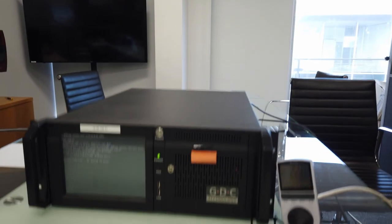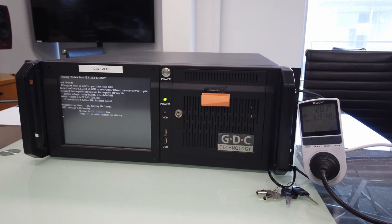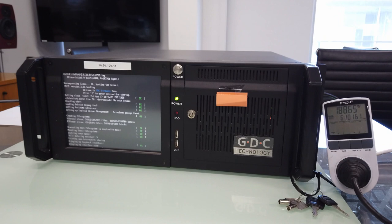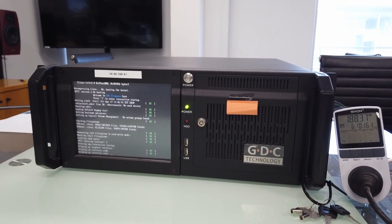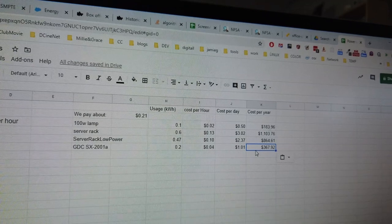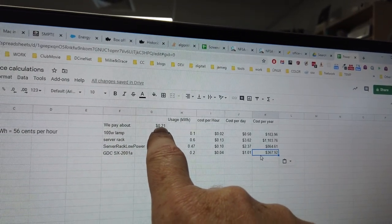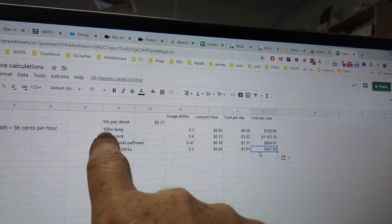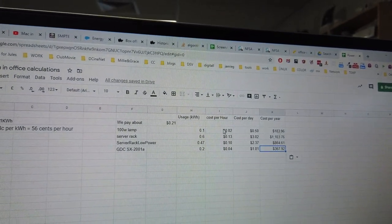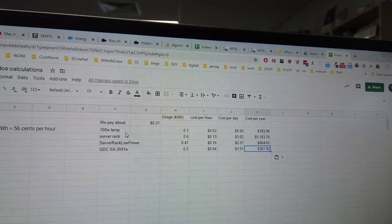In general this server, when it's doing nothing, will eat around 200 watts, and when it's playing probably a bit more — decoding, decompression and other bits and pieces will add to that. So if you are leaving something like this on at night, we'll go to the calculator now. Here I've got a little spreadsheet I created in Google Sheets — I've programmed the kilowatt hour rate at 21 cents, and 100 watts equals 0.1 kilowatt hours.